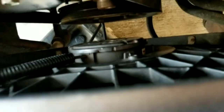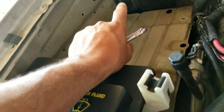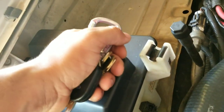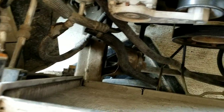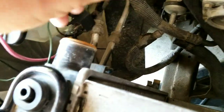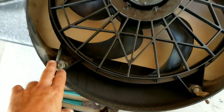Here's the stock one — it's mounted on the stock fan shroud. We're going to take that off and work on it. We're missing the battery so I'll show you what's going on in this space, and we're going to possibly eliminate that too. To pull out the stock fan shroud, there are just two bolts up top. Remove your cooling line, push it to the side, pick it up sideways, and it comes out clean.